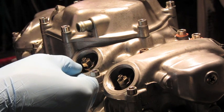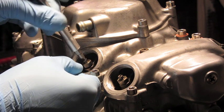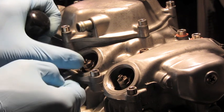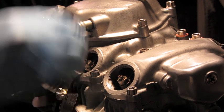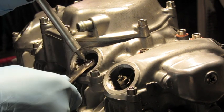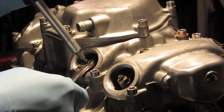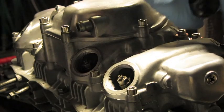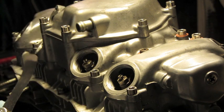Putting the feeler gauge under the tappet. Once again, we're going to tighten the tappet down with the flathead. Back it off so we just get some resistance, like so. Screw the hex nut down. Check your adjustment again. And then tighten the nut. Checking this again, if it's still good. Okay, pretty simple. And then now we're just going to do the inlet, and we're just going to use the other gauge, which is the 0.05, and that's it.